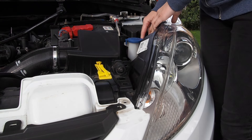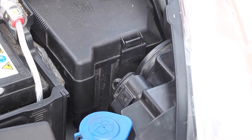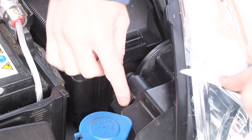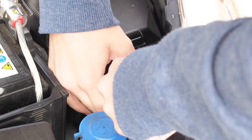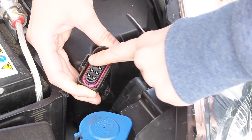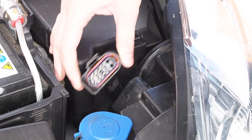Then you need to try and unplug this wire here. So we need to unplug this to be able to get it in. If you get a little knife and put it underneath this gap, it will push the little lever down — it makes it so much easier to get out. Right, it's that lever there that you need to just push down on, and it's out.